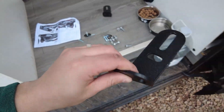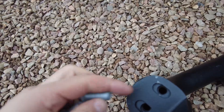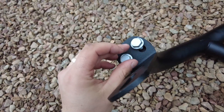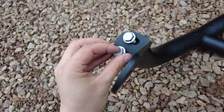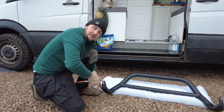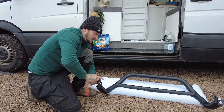So these are the brackets that will be getting attached to the bull bar. This one will basically go on there like this — put one screw in there, pop another one in. We're just going to loosely fit this so that we can straighten the bull bar up from the front, then tweak it and get it all nice and tight. I'm just going to nip these up slightly, not much, because I want to be able to adjust it when they lift it onto the bracket.